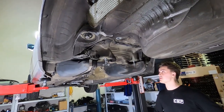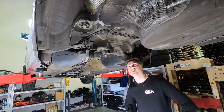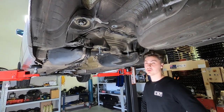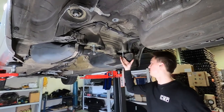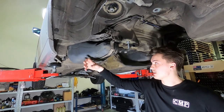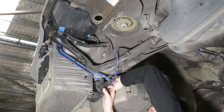Well, now that that's out of the way, it's good to have a good look at these mounts, and it's a relief to see they're not too bad. A little bit of work, but nothing unexpected. Before we can call it a day though, we've got to get this fuel tank out. Simply put, we're going to be welding these front two mounts as well as stitch welding the rear trailing arm mounts into the chassis, so simply no way of avoiding it. So let's wrap up with that.